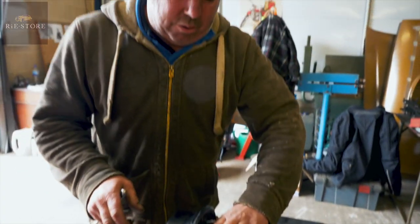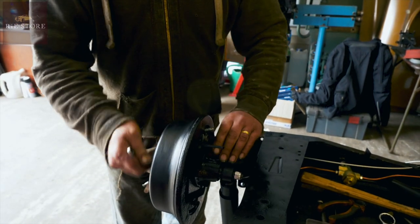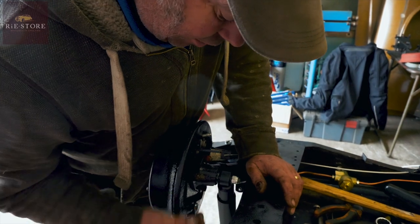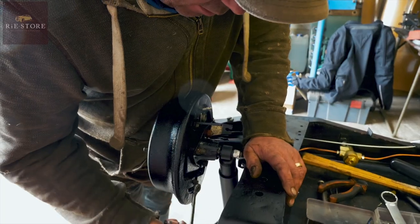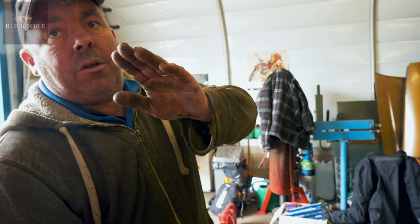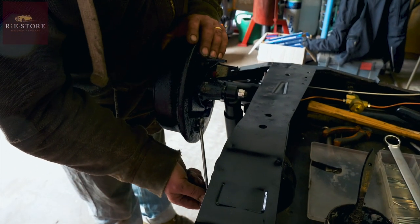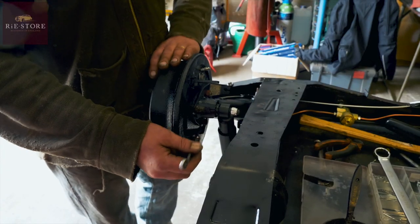See that'll centralise the top part. So you just keep going, keep adjusting them up. You can lock them up really hard, rock hard, and then back them off. See that spanner? You know I said it had like a castellation, it had like flats on the dome. So you feel that, that's tight. It'll click round, donk, that's into the slot.